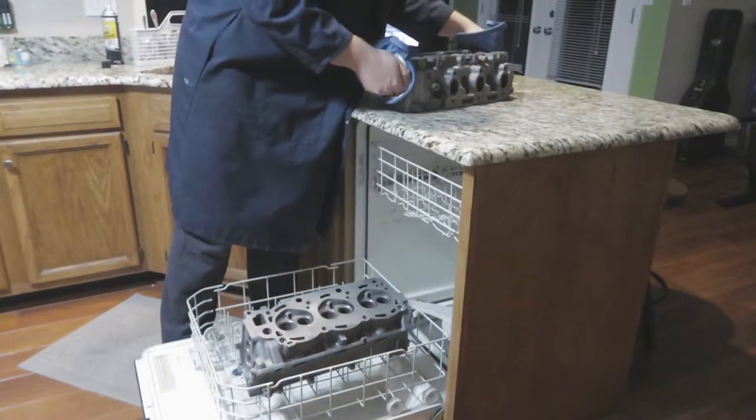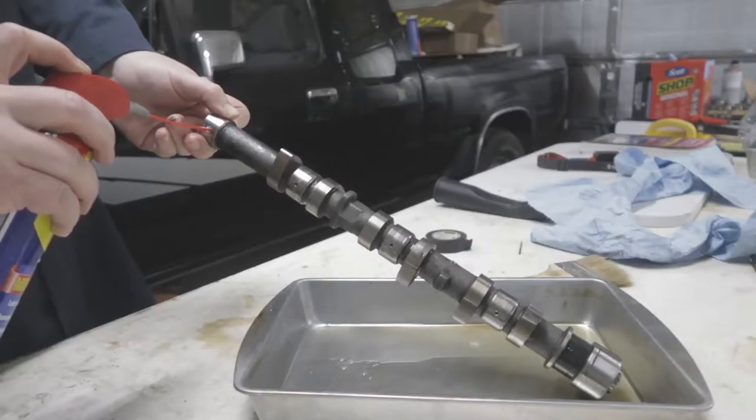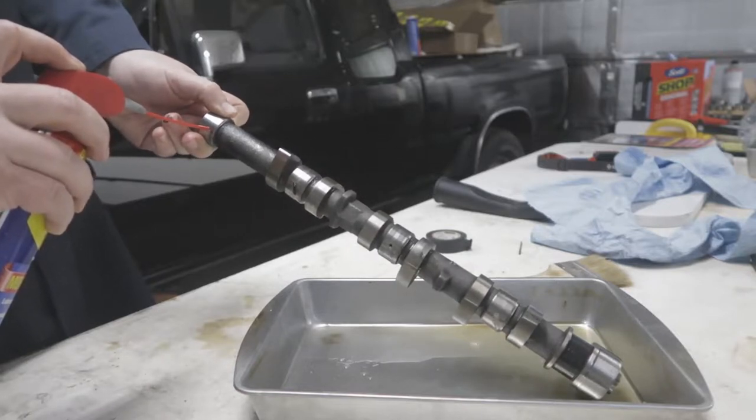Hi there and thanks for joining me while I continue to work on my 1989 Toyota pickup. Over the week I installed the last valve since it made its way here from Alaska. Because I had new valve seals in the rebuild kit, I decided to pull all of the old valve seals off, and before reassembling everything for the last time I put the heads in the dishwasher to give them one good last rinse. After that I pressed all the new seals on and installed all the valves for the last time. I also sprayed cleaner through all the oil passages in the camshafts to make sure they were cleaned out, and that puts us where we are today.